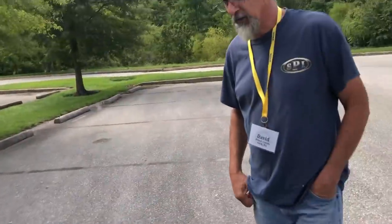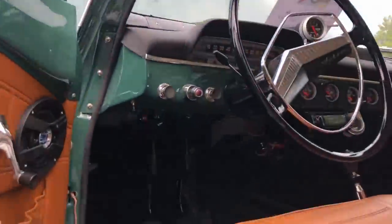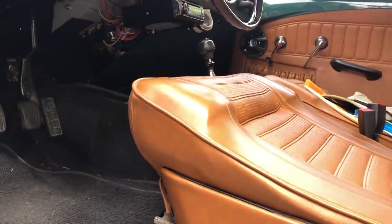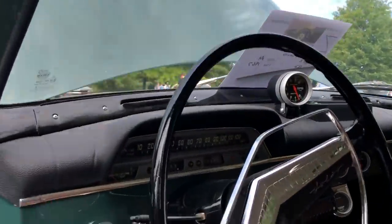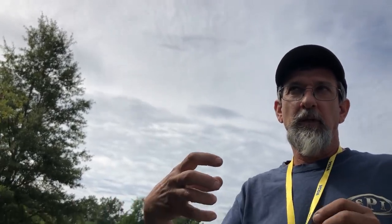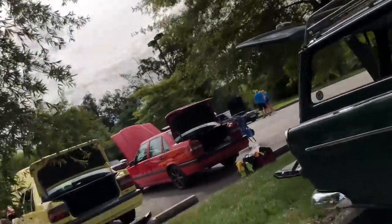The only thing that's not Volvo on the car is the brake setup and the motor mounts, which are small-block Chevrolet motor mounts. Other than that, everything else is Volvo or custom. I redid the fronts to 240 vented disc brakes - all 240 with the correct bolt pattern. For the conversion, if you can get an ES hub it works, but they're getting hard to get. I just took the original hubs and had my machinist re-drill them. The original caliper mounts for the Amazon I cut off and made my own piece to mount the calipers.